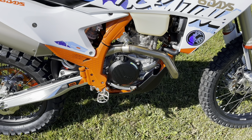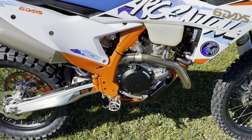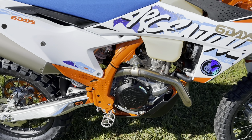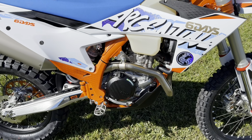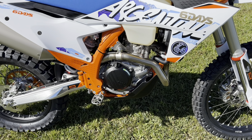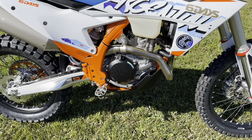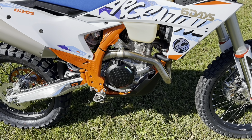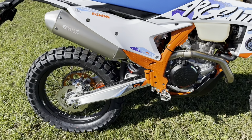And for real fuel management, for fuel trim management, when we eventually, very soon, it's taken a long time, and I know that a lot of riders are waiting for that, and so are we, but eventually we'll have a wideband closed loop system with the Get ECU, and that will come with an 18 millimeter wideband heated O2 sensor. That'll be race grade, automotive race grade, and that'll be a big upgrade.